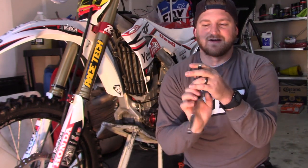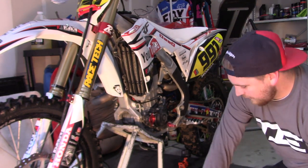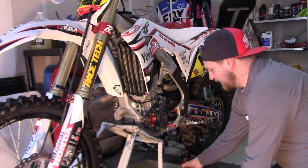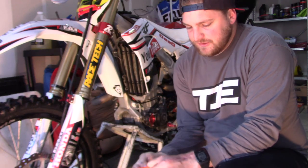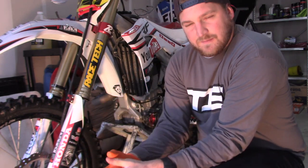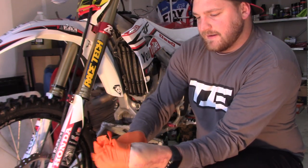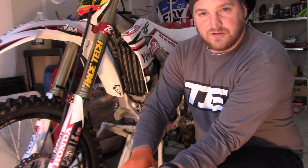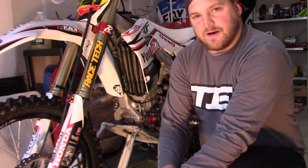Holy cow. Today is one of those days where nothing wants to cooperate with me. My batteries keep dying. But grabbed a charger - we're going to persevere. So we got our 3/8 drive ratchet and our hex head for the drain plug, and we got our drain pan. So with this unique setup we got here, we are going to crawl underneath - got a little bit of room to grab the drain plug, not as much as you might like, but it should be enough to get the job done. Actually, we're not going to drain yet - what we're going to do first is start the bike. We haven't drained any oil out. So we're going to start the bike and let the oil warm up and circulate so it'll drain a bit faster, as well as pick up all the debris from the engine to make sure that we're getting all the crud out with the old oil. So glad I caught that. Let's go ahead and fire it up.